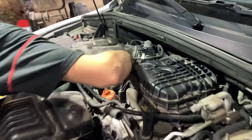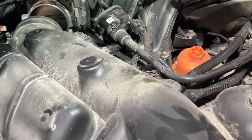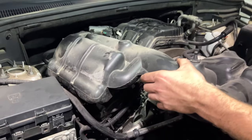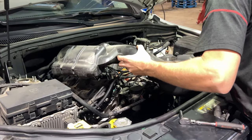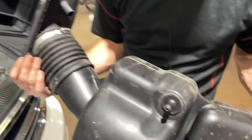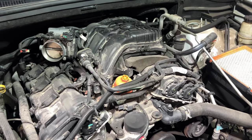We also need to disengage this — there's a rubber band on the bottom of this valve. That's your purge control valve for your evaporative emissions, and it just slides onto this tab. Put that off and we can remove this whole intake. There's that peg I was talking about — those break off all the time, so be careful.